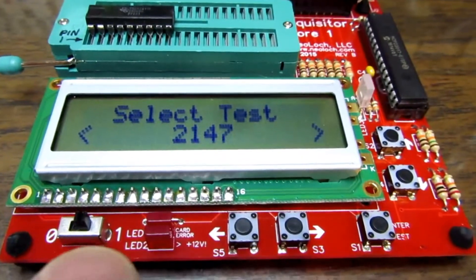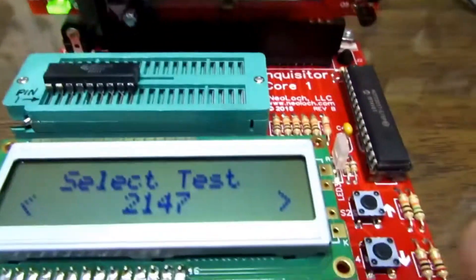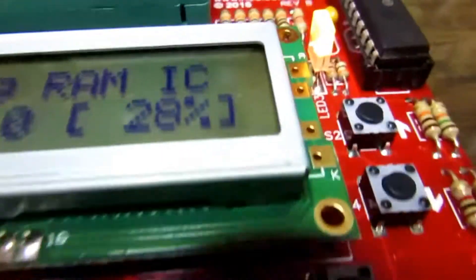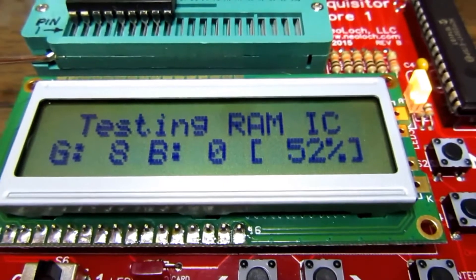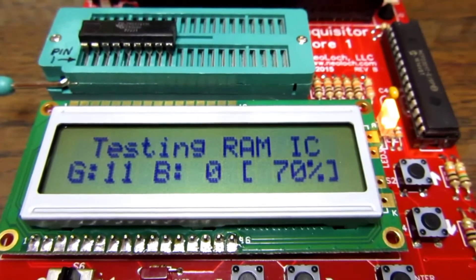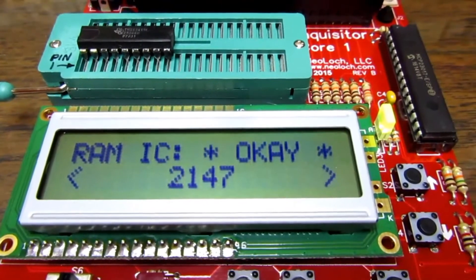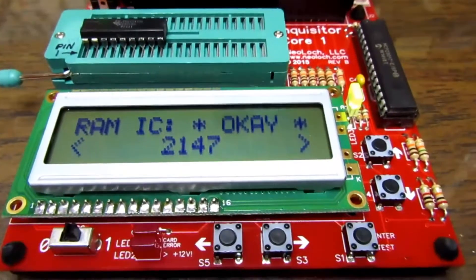Right now none of my alarm lights are on. The power light is on to the adapter blade and the status LED is off. I push the enter button and it's testing the RAM. It's kind of hard to tell on this camera, but the LED is glowing orange, letting me know it's testing. This is just doing a simple once-through test, though it can be set up to do more elaborate and repeated tests any number of times. It's giving me good and bad results, and it says it's okay — the LED changed to green. That's a simple one-through test and basically how it works.